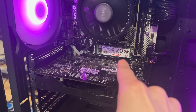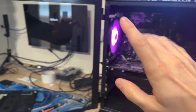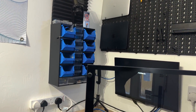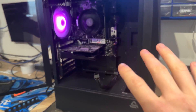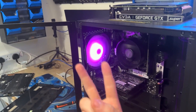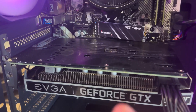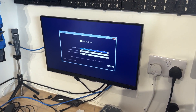As long as that is the boot drive - I don't see any SATA data cable coming out elsewhere - so it's definitely that. We're going to swap this over and do a full clean install because I guarantee I won't be able to get in otherwise. So plugging in my USB drive with Windows on it. Just threw it in and screwed it in just in case it's a motherboard problem - but look, it's actually managed to load onto my USB.